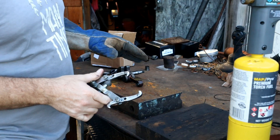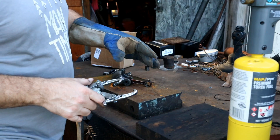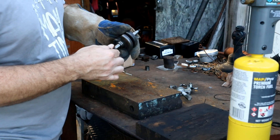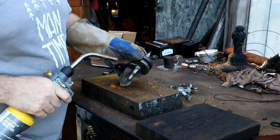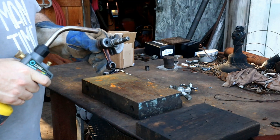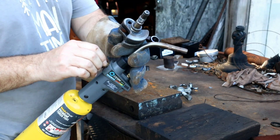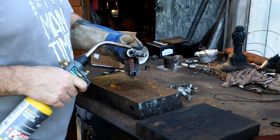I've got a set of pullers — two-jaw pullers out here — and it looks like this really small set is going to get close, but we've got to do some modifying to the race here so it'll actually grip a hold of it. You can see I've got welding gloves on here — I don't want to take any chances. We'll open up our gas here and start with the heat, just going around, and then we'll tap it.